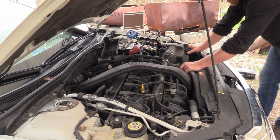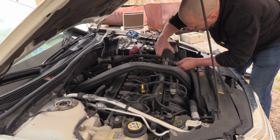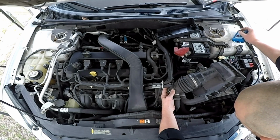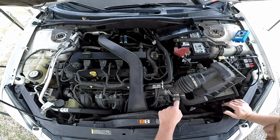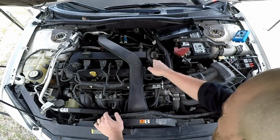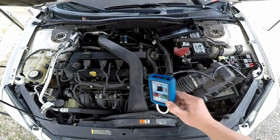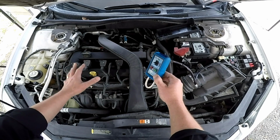That's not going to set an air pump code, but let's get this out of the way. Let's see if I can feel the inlet of that. Yeah, so that's my inlet tube for the pump. And then my discharge way up here. Okay, so pump runs, we hear it. That doesn't tell me my flow's right, doesn't tell me my amperage is good. We can do an amperage measurement with this tool too, but I'll save that for later. We'll put an amp clamp on here if everything else tests good.